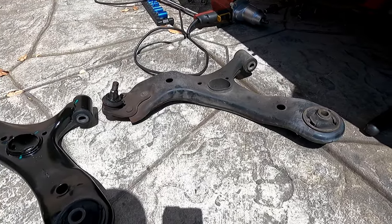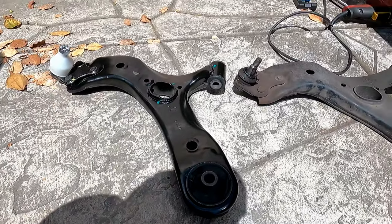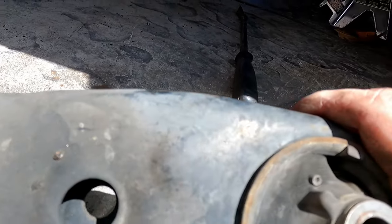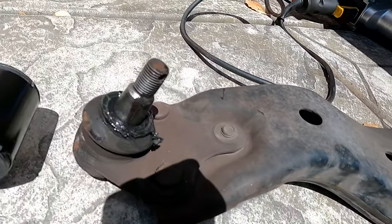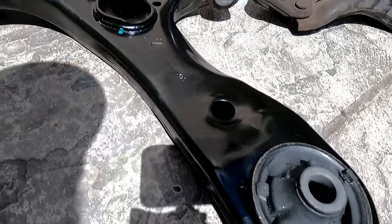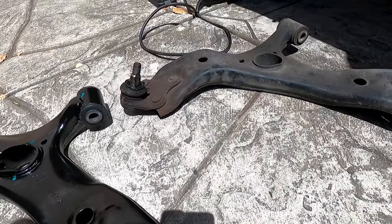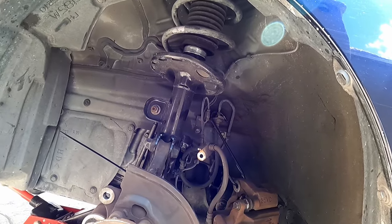Willie wins — the Scion gave up its parts. We still got one more side to do, but at least I got the arm out. I really don't see any damage that's obviously causing the clunking sound, but there are some stress cracks in the bushing on both sides. The car has about 140,000 to 150,000 miles on it, so it's okay to change them. The new one looks good — just like new — and it comes with a brand new castle nut so I don't have to reuse the old one. I still don't really see what's causing the clunking. We've already changed the strut — that's in another video, I'll link it in the description.